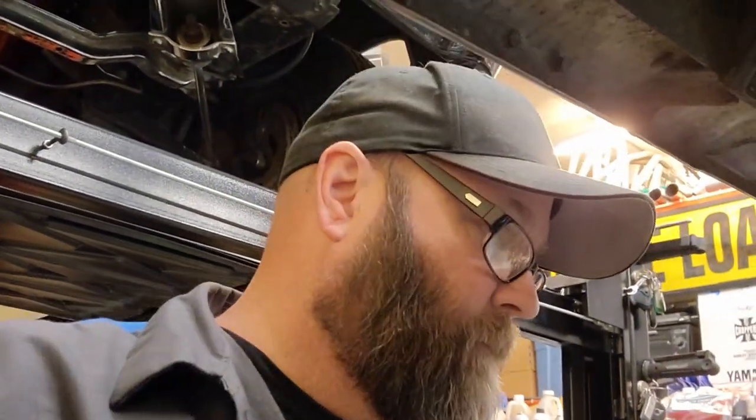So I am going to try jumping from terminal 2 right to the battery terminal on the back of the alternator. I don't know why that makes a difference, but they say you can run them that way. And if that doesn't do anything, then I might have to take the alternator back apart. Maybe I did something when I put it back together and the brushes didn't line up and one of them's hanging in there. We'll see. Okay, so two steps forward, one step to the side, one step backwards, you know, hot rodding.